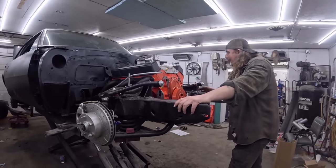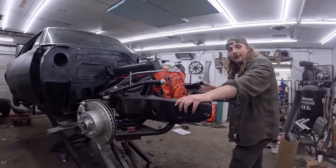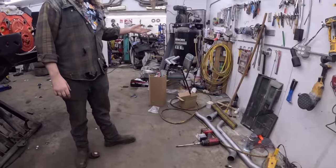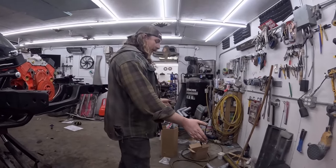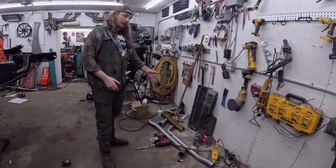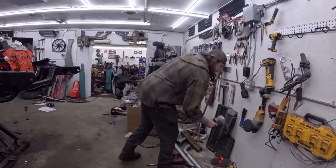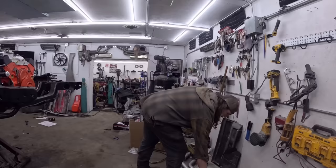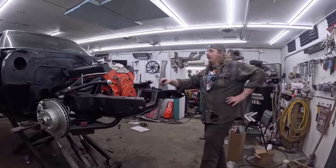The plan was that and tackle the exhaust. Actually, this is yet another video where I thought I was gonna do the exhaust, and I keep pushing it back. We're finally maybe gonna get there. I had actually started working on the exhaust. I don't know if I'll be able to put some clips in there, but I know I did some welding. This front or intermediate pipe was originally an H pipe, which I decided to cut out and make just two individual pipes. Then I made some collectors to work with what we've got going on. After this, we'll cut to me making those. Otherwise, obviously the thing is all apart.